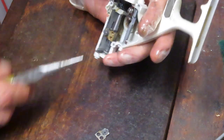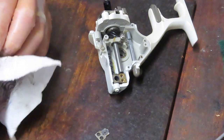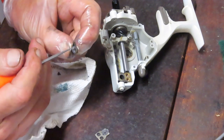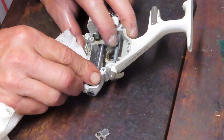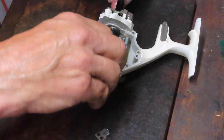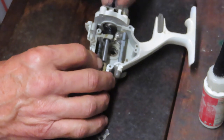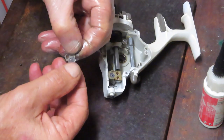Here's your pawl — check it, clean the dirt out of it, and make sure the shoulders are clean. Run something across there to pick up any excess dirt or grease. On the carrier there's a little washer that goes over the point of this pawl. I'm going to reinsert the pawl and put a drop of oil on it. Get the pawl seated into the groove — you'll know it's seated when it comes down — then place that little washer over it.